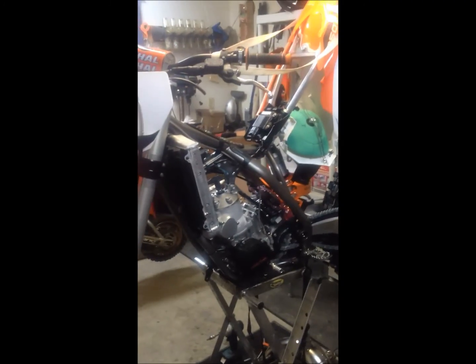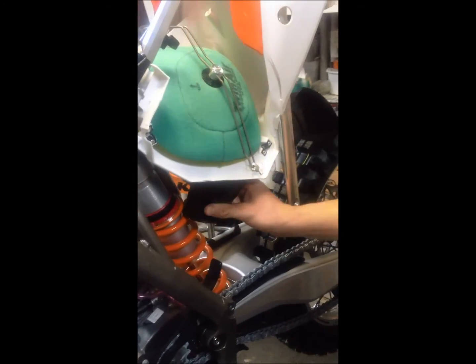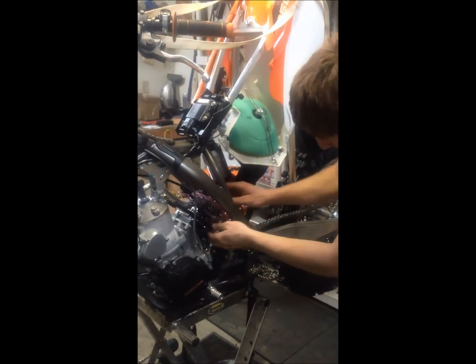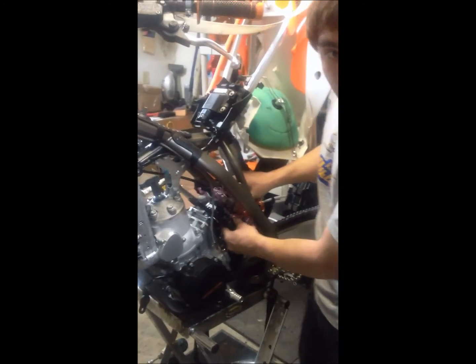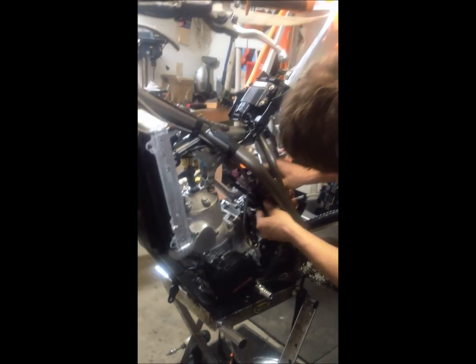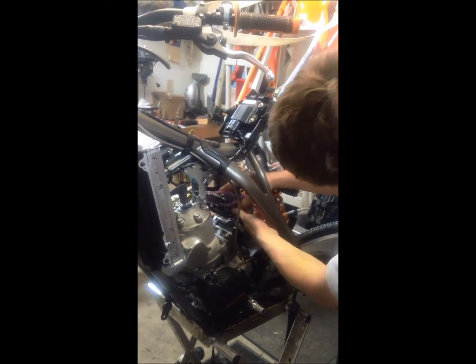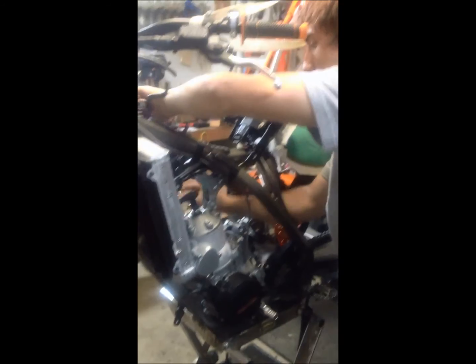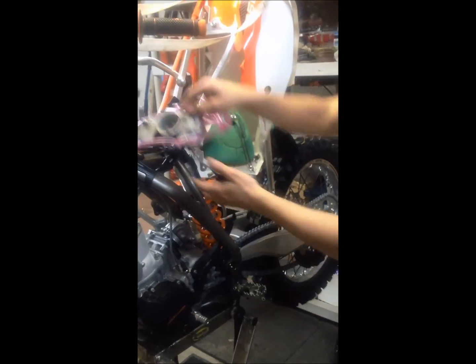Now, the ring that just fell was the ring that I pre-slacked, holding the carburetor onto the back rubber here, that holds it into the airbox. Take this ring out. Once that ring's out, jiggle the carburetor out over here. Turn it a little. Then once that's out, I'm going to bring up and out the hoses, send the carburetor out to the other side, bring it up, and place it down here for now. And that's how you take off the carburetor.